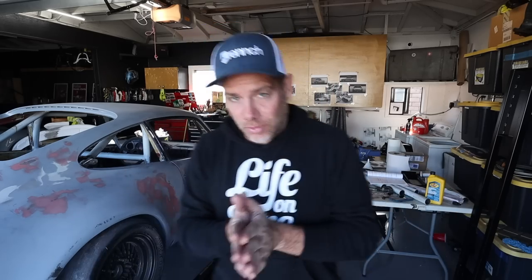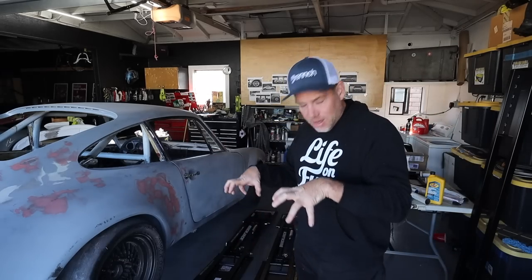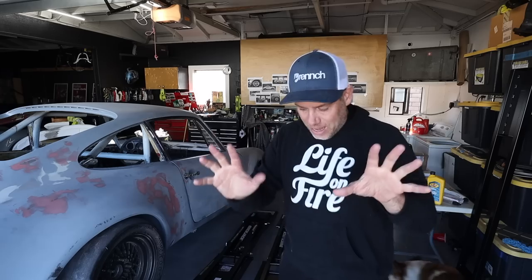Welcome back — a couple days later. I had to give the thread sealant 24 hours to dry, and we had a ton of rain so I couldn't work on it. After 24 hours, I've made a conclusion: the thread sealant sucks, don't use it. I went on YouTube and searched for 'leaky QuickJack,' and they actually have a video on this. They only included the thread sealant because people weren't applying Teflon tape correctly. When doing Teflon tape, you wrap it righty-tighty — the same direction as tightening — so it keeps the tape on the threads, doesn't bunch up, and doesn't send tape down into the filter. So I redid everything with Teflon tape on all connections and rebled the system. Now I think I can actually try to jack the car up.